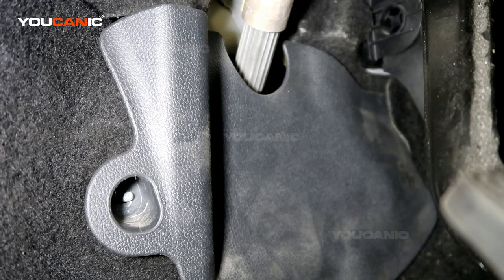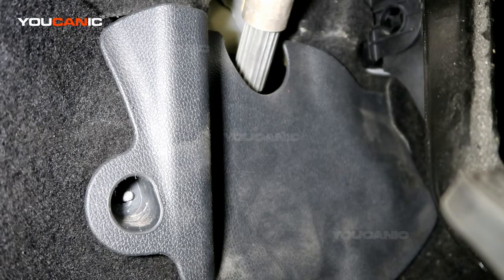You may need to replace the whole module or individual pieces. The way to get it out — at least the way I've figured out — is to take pieces off and drop the whole front crossmember. I'll go over this process in this video. A good place to start is inside the cab of your GLA Mercedes, and this will be pretty much the same on most vehicles with electronic steering assist.